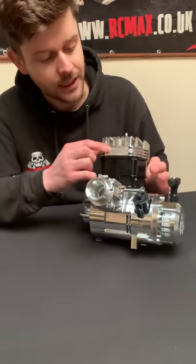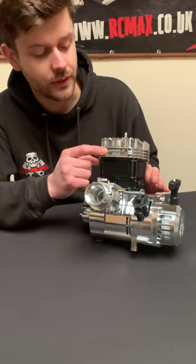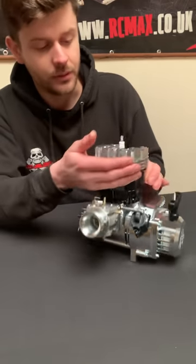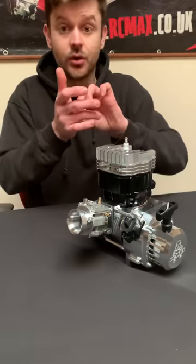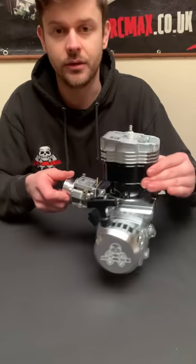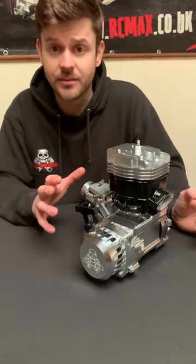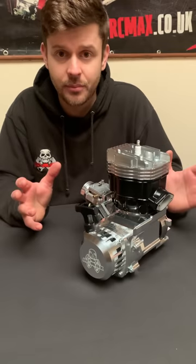Air is forced up on the exhaust port side - the hot side of the engine - in the same direction of flow the cylinder was designed for water, but we're using air. It comes up around the exhaust port, up around the top, then forced around to the back of the cylinder. The cleverly designed cylinder head has a machined port underneath the head that allows the air to escape on the intake, the cooler side. We're moving the heat away from the hot side, evening the temperature, and bringing it round to the cooler side.